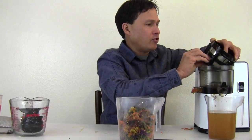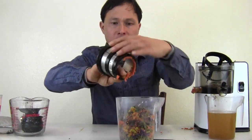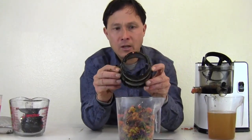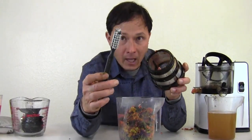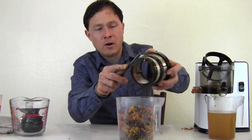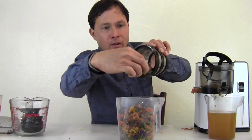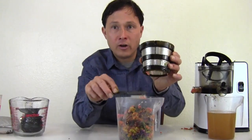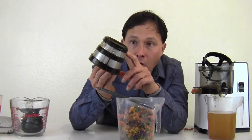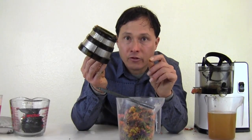Next part to clean is the screen. Pop it out — very little pulp left over. I like to take my finger and scoop around here and drop that into the pulp catch container so I can compost it. Then take the special cleaning brush that came with the machine, run it under water, and brush it as you're turning it — brushing and turning all the way around, bottom screen and top screen, then the inside. It's very important to clean your screen properly. When done cleaning, look up through the light and make sure you can see all the holes — stuck particulate in the screen would reduce juicer performance over time.